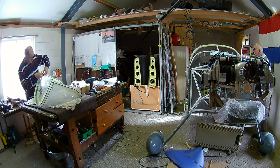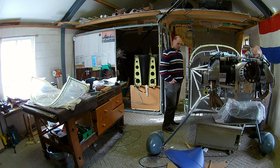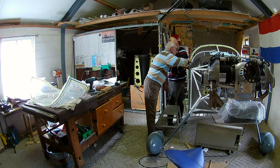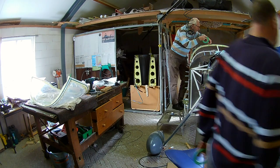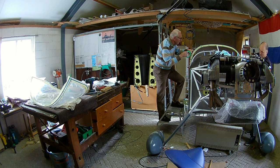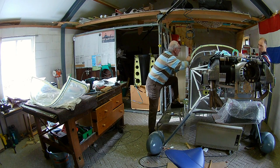And then there's still a second layer of tape, because Sikaflex will stick to anything that holds primer, but it just won't stick to stuff which isn't primed. So it's kind of a two-component thing.